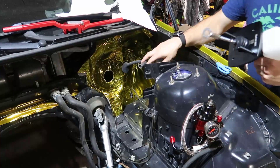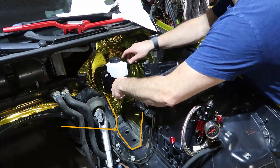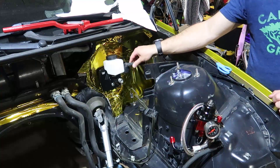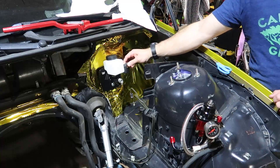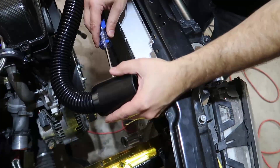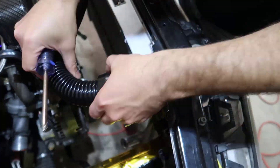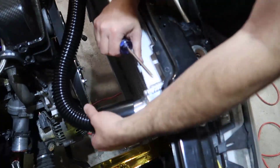This is the main intake manifold — the FFIM from eBay, super cheap at $100, but super hard to install. My arm got stuck twice. Because the intake is so big, I needed to cut where my left arm area was enclosed. I deleted the brake booster and the ABS module — got a kit from Chase Bays, totally worth it. The flex hose itself is great, but the connector is not good. Do not use that — buy a silicone hose instead.